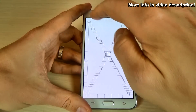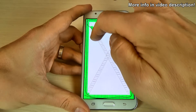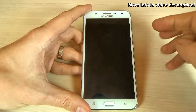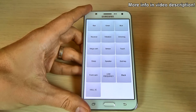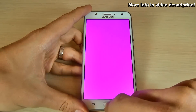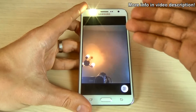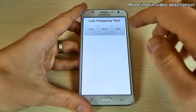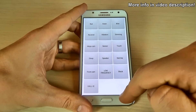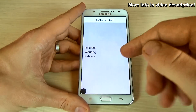And the touch screen test — you must complete it to exit. This is the sleep mode and the speaker test. The sub keys — here we test the keys of your phone, everything is okay. And this is the front camera. Some low frequency tests: 100 Hz, 200, and 300. This is the black test and we have here some magnetic test that I'm not sure how it works.